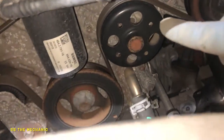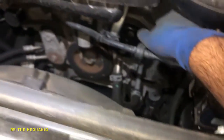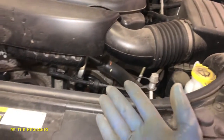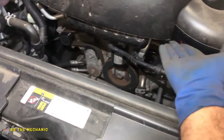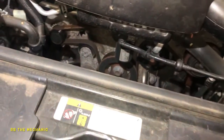After that, you want to check your water pump for leaks — water pump is right down there. Also do your thermostat on time. Don't bother testing the old thermostat by putting it in boiling water to see if it opens and closes — if you've got it out, just replace it. Do your thermostat at 60,000 miles.